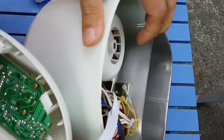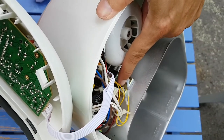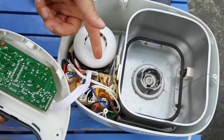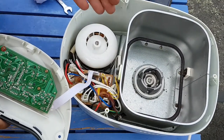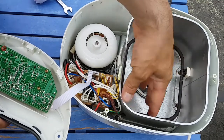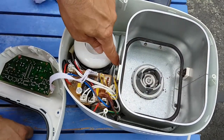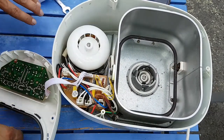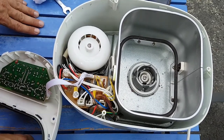The other part of the puzzle is that there, which is a temperature-dependent resistor, a thermistor. That is an analog device that is fed back into the microprocessor so that it knows what the temperature of the cooking area is. Finally, the two little things down here are fuses. If the temperature gets too hot, click, it finishes, it's done.